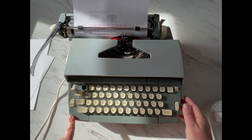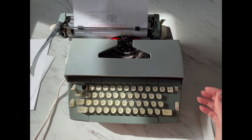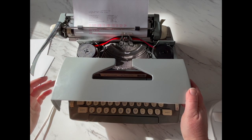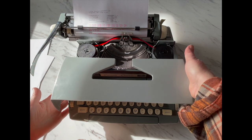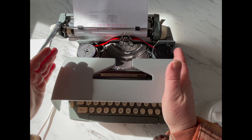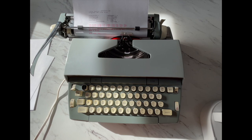This is your on/off switch — we're going to turn that on. That sounds nice and good, it's not too loud. If yours is grinding, there's a chance that the motor, which is on the left side, is rubbing up against this metal piece. If so, gently just push from the right to the left, and that'll move that cover just a little bit so that the motor's not grinding against it. Please be gentle when doing that.